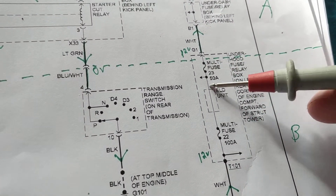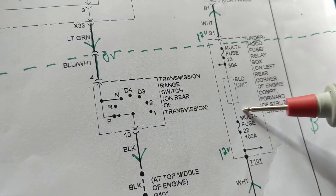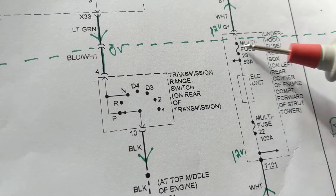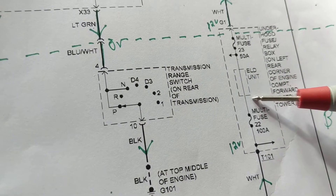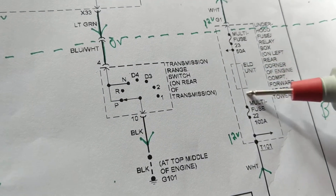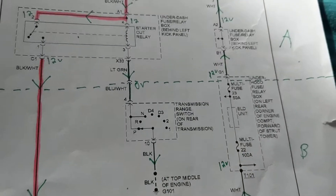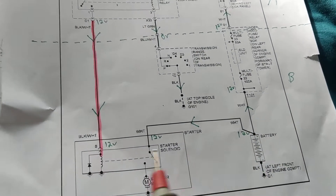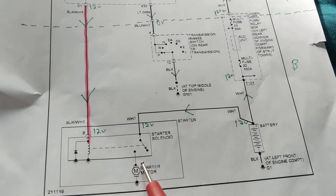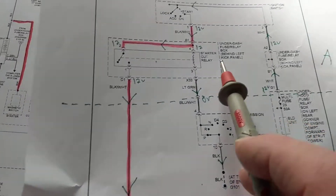This fuse is connected to this other fuse by a wire, so think of it like a center tap — like a potentiometer. That's one terminal common to both. There's a dotted line around these two fuses because they're in one package — it's one fuse, but there's a center tap in between. One side goes to this terminal, the other goes to the other side. So you have a center-tap package with three terminals: one common terminal and two others.